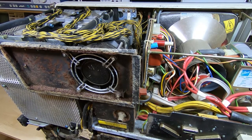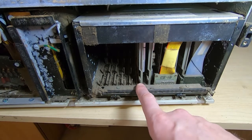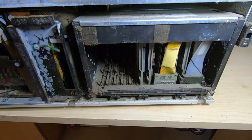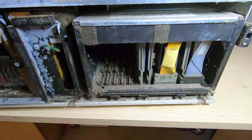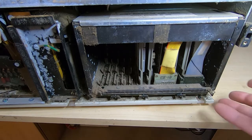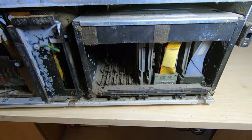There's even more dirt in here, and if we look inside the card tray — absolutely filthy, probably one of the worst ones I've ever seen. I've got no idea where this was used or stored, but what normally happens is it builds up dirt, then you get moisture in there, the dirt traps the moisture, and it starts to corrode. This is probably repairable, but it depends on how severe the corrosion is on the motherboard and whether it's made its way up into the main cards. I'll start by taking the upper modules out — the big ones such as the floppy drives and CRT — and then we'll be able to pull the card tray out. I've got a feeling it's probably corroded in place and I don't want to break anything by trying to slide it out.